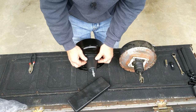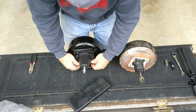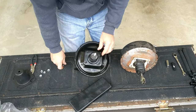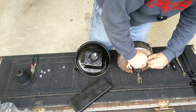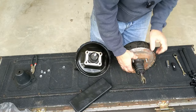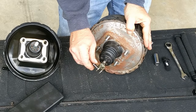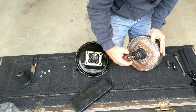Remember, these nuts are 13mm on the new unit — if you want to use them that's fine — but I'm going to go back with the 12mm ones to keep things consistent with Mazda. There's no gasket here so I'm going to try and salvage this little gasket and reuse it. This slot here is where your brake pedal goes, and this is the pin I was talking about — the bigger pin goes through and then there's a small keeper pin, so we'll have to transfer all of this to the new one.